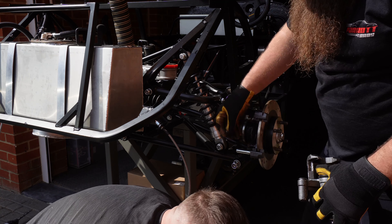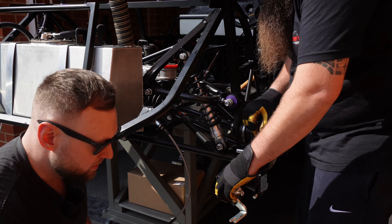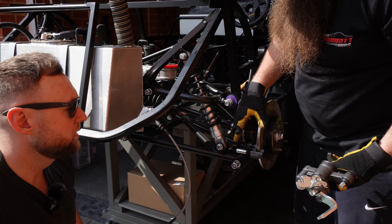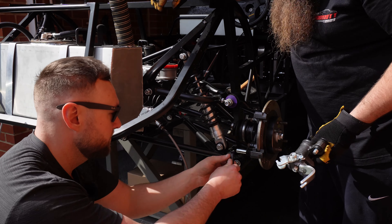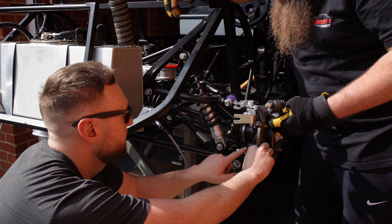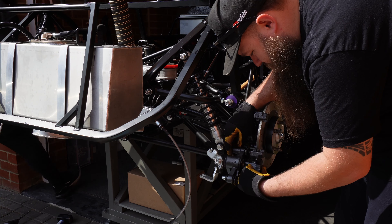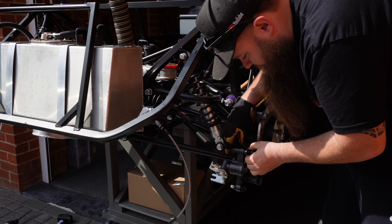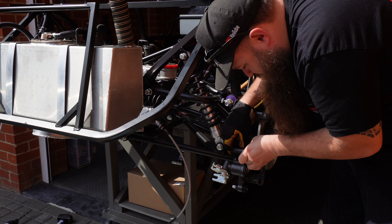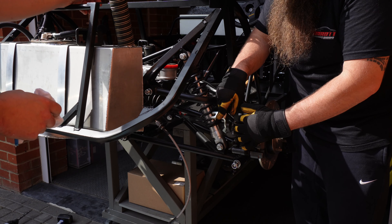A bit of grease. The boot now needs to go over this one - it has a line where it sits. I've got grease already in the hole. So we'll slide a bit on the old shaft, rub it all over. Then this should go on there like that. We've got to try and get the boot on, which is the fun part because it's so slippery - it's not that big so you have to kind of persuade it on. Then we do 180 degrees and that will sit on there.